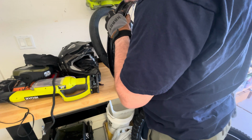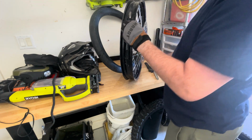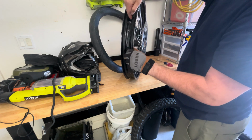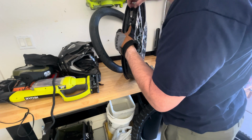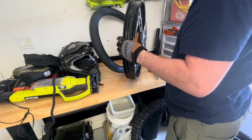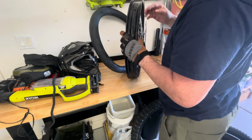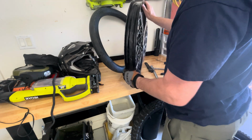that has been neglected by the installers. I'm really upset about it because they put it on the side. When I opened up this tire and looked inside, the valve stem was in just like that. Not good, not happy. It should have been like this, covered with the valve stem in. So just check for things like that. And now, since this one is almost about to rip, I don't want to chance it springing and unloading while I'm riding.